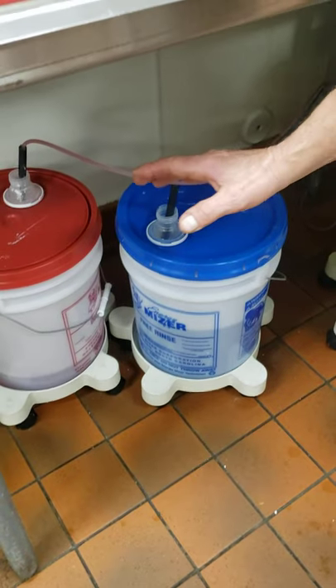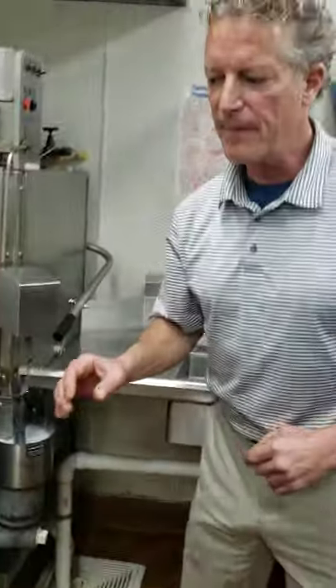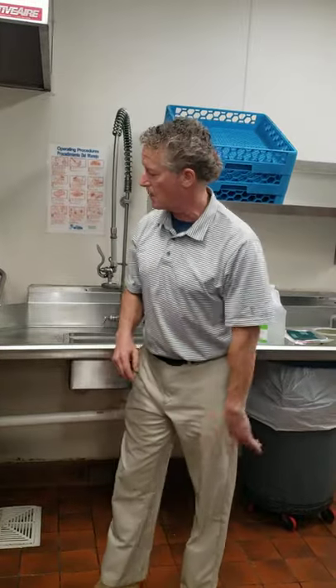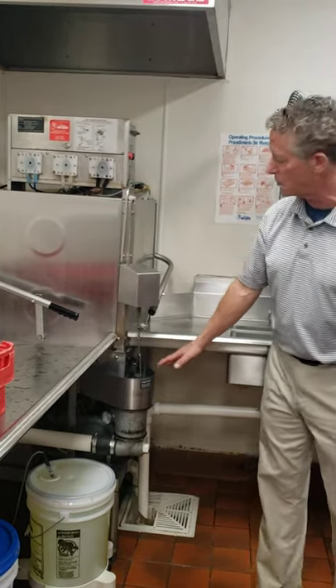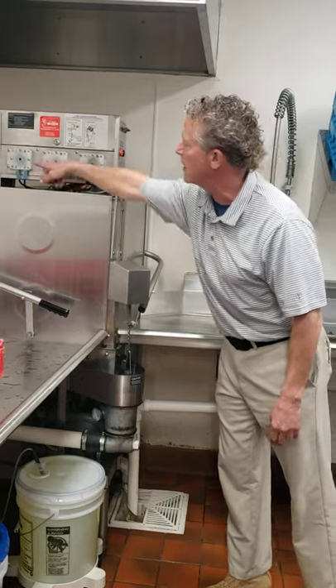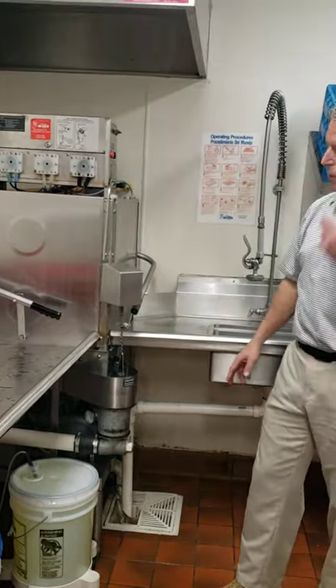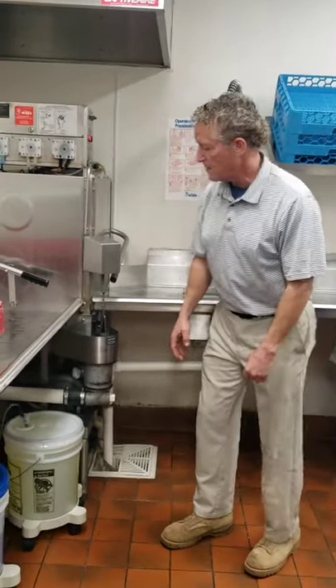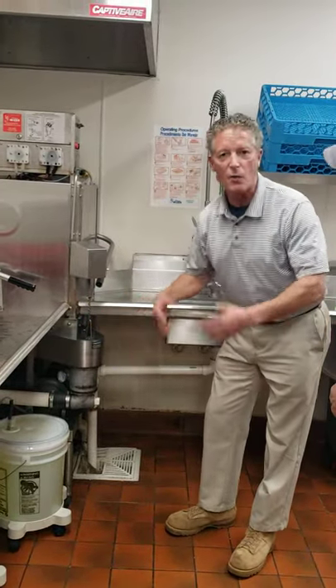You've got to be very careful when dealing with these chemicals. You want to wear gloves and goggles. Treat these chemicals with respect, especially that red one. If it gets on your skin, use cold water and soap as well as white vinegar. Now you'll see that the drain is activated and the machine is filling back up. You've got to make sure that you have at least 120 degrees temperature. There's the chlorine wheel spinning and the free rinse wheel spinning — you can see the chemicals coming in. Make sure you have chemicals in the bucket, the right color line going to the right color chemical, and that you actually see the chemicals going into your machine.